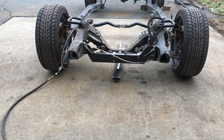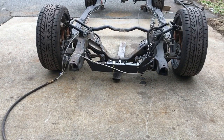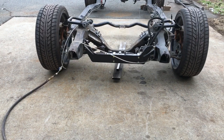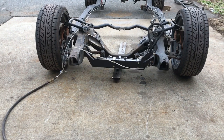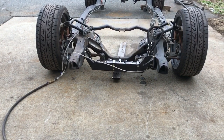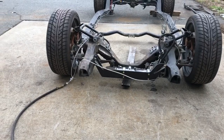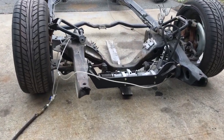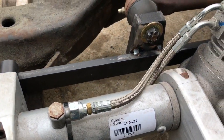Now that all the work is done and I've made my corrections and tack-welded them back on, let's articulate the suspension and see what it does. It's not nearly as bad — it's almost 100% corrected, 100% better almost. Nothing's perfect, so we're still getting the actual camber issue, which you're going to get when you articulate a control arm suspension. But I'm happy with that. It did correct the actual toe-in, toe-out bump steer issue without spending any money. You can see where I moved the actual inner tie rod end mounting tabs — I moved them up and just tacked them in.